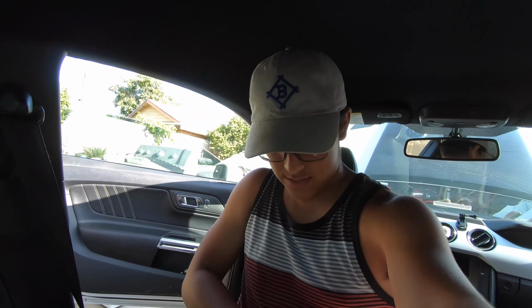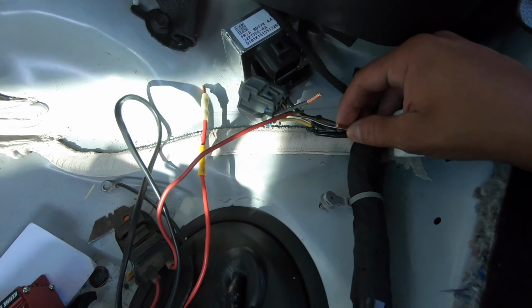So once that happens, I get the wire that I'm gonna be soldering with and the iron. And what I do is I touch the two wires themselves with the iron, and you start seeing the paste begin to boil or bubble, however you wanna describe it. And then that's when you get the wire itself, and you just touch it, and you leave it there, and the copper wire starts taking the solder easily. And it's really easy, especially when you do it this method.